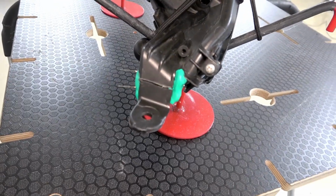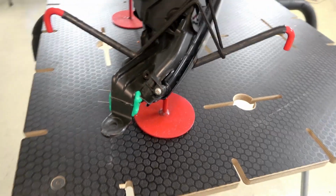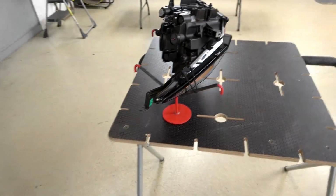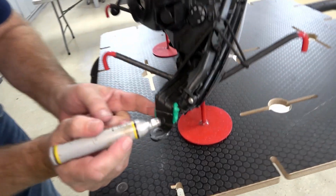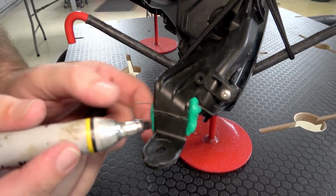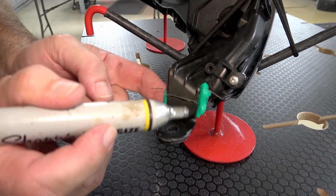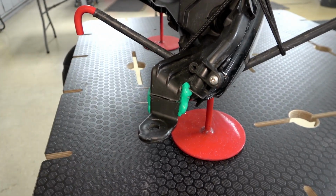So you can see the crack running across there and the green putty, of course, the staples holding it in on the sides there. So what we're going to do here is V groove across the crack itself. And since it's on an edge right here, we're also going to T our welds right here on both sides.